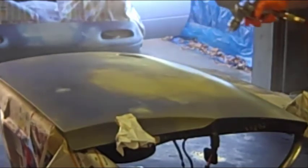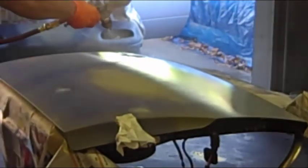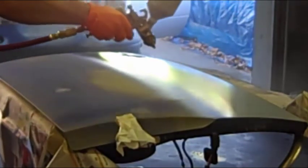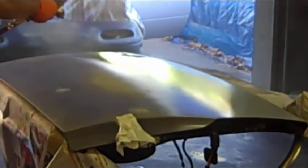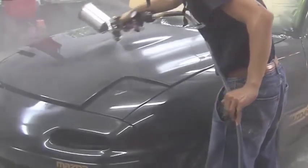I can give you examples of how it's supposed to look. In this clip, I'm shooting primer onto a door and you can see how smooth it's going on, laying on really nice. I had it set so I didn't want it to lay down real heavy because I wanted to control my coats. I'm spraying it evenly — not dry sprayed, not too thin or too heavy, just going on normal. The end result comes up nice and smooth. Also you can see in this clip painting the hood and trunk, how the paint's supposed to look going on when you're painting.